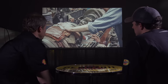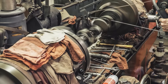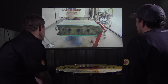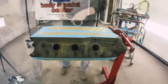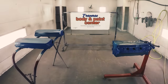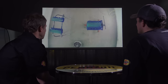This is just a quick crankshaft polish — we measured everything and it was within spec, so we just did a quick polish to take off any roughness. Now we have a beautifully clean block. Some people like to paint after assembly; I prefer to paint before because that's the cleanest that block is ever going to be. We used epoxy primer, then automotive single-stage paint — not a two-stage with clear coat, but it has a lot of gloss and holds up very well. There are two blues in the Ford world; we went with the darker blue.